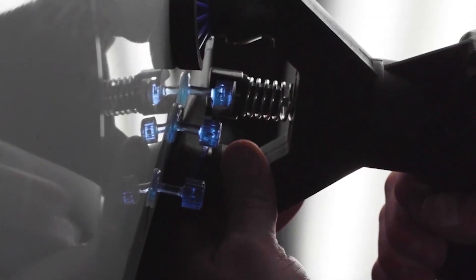When folks come to a trade show or call us, many say they just need the rough out. But then we talk about blend panels and how inefficient they are. In a conventional non-glue-pull repair method, you're putting filler even in smaller dents and doing blend panels. By having the Level 2e system, you save those blend panels because we can get damage to what we call a blockable level — where it doesn't require filler. That's one of the major advantages of the full system.